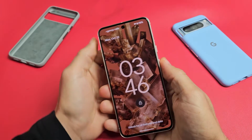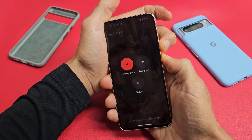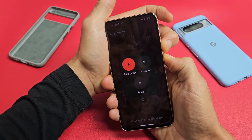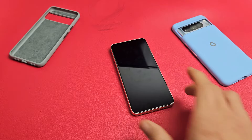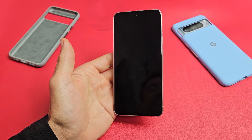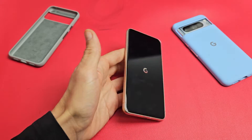If you're still stuck in a boot loop from here, no problem. Do the two key combination again — power button, volume up, ready, set, go. Press and hold both buttons, pretend I'm still stuck in a boot loop, keep on holding. When the screen turns black, count to five seconds, then let go and let it boot back up and hopefully you'll be out of the boot loop. Just be patient — wait for the boot up.